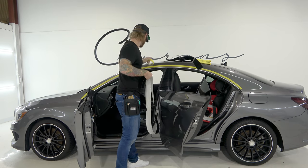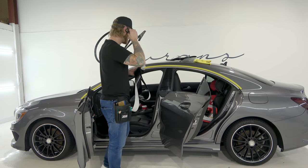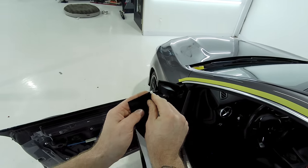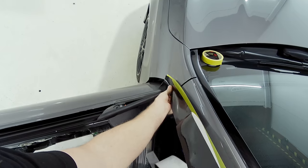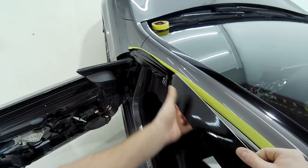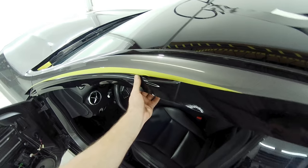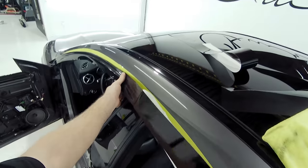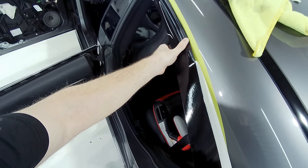Let's get our piece of vinyl and lay it down on top of the trim. It doesn't have to be curved to the actual panel itself — it just has to be straight and the right length. I'm going to start from the front since I'm right-handed. Start reeling off the release liner as you come along — just pull it taut, not a lot. It's just tight enough to get the film to contour around this piece nicely. As it curves a little more at the end, add a little bit more stretch to the film.